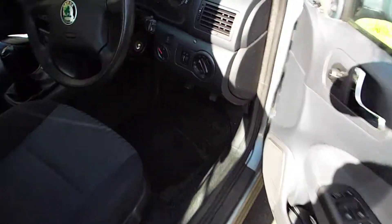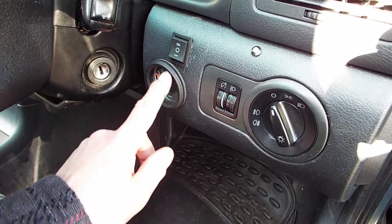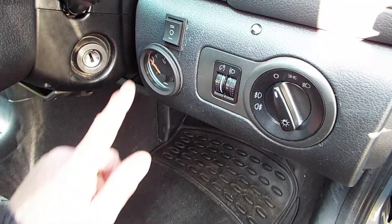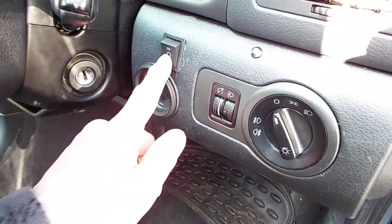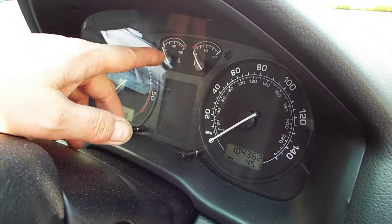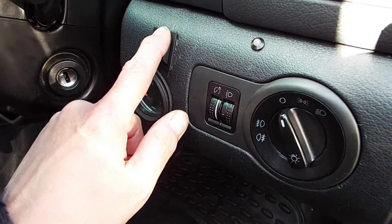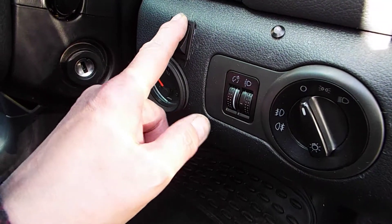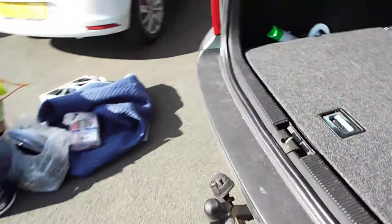I'll just show you the switch on/off here. This is available at biotuning.co.uk. I've fitted a three-position switch: when it's in the centre, the LED is off and that's running on diesel. Switch to the bottom position, the LED will go green and that's now running on vegetable oil. I switch over to vegetable oil as soon as my gauge up here starts to read warmish. When I come to park up at night, I'll just switch up to purge, which switches back to diesel and lets the diesel run through the system and back to the small tank. So purge — about 15-20 seconds.